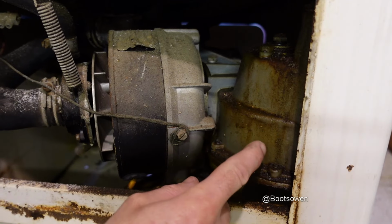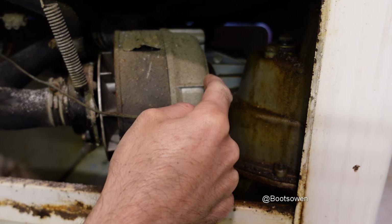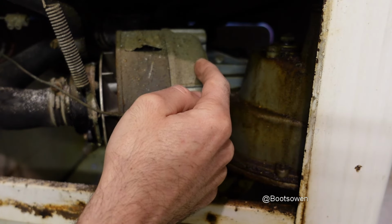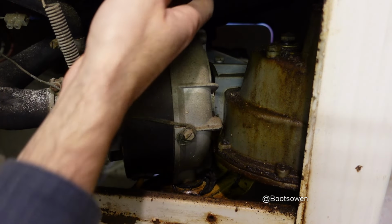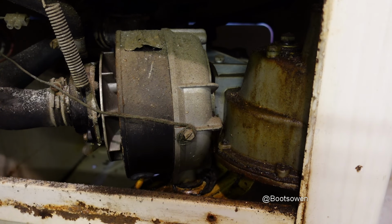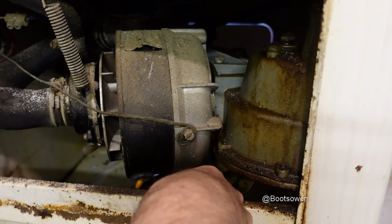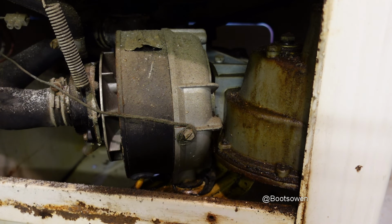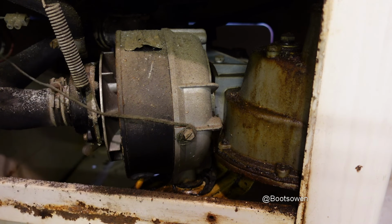To the right then, you've got a takeoff coming from the motor, and I'm guessing this is a gearbox, and I think it goes the whole way underneath to beneath the tub in here, and then there's a shaft going up to drive that mangle, and there must be a shaft to drive the agitator. There's a rubber bush here down below, and it's turned to jelly, so that motor's not sitting in a bush the way it was once meant to. That's an issue. There's also a lot of oily residue down there on the 3 cables coming into the motor. This is an earth. It's just a bare nickel plated earth. There's not much more to see down there really.